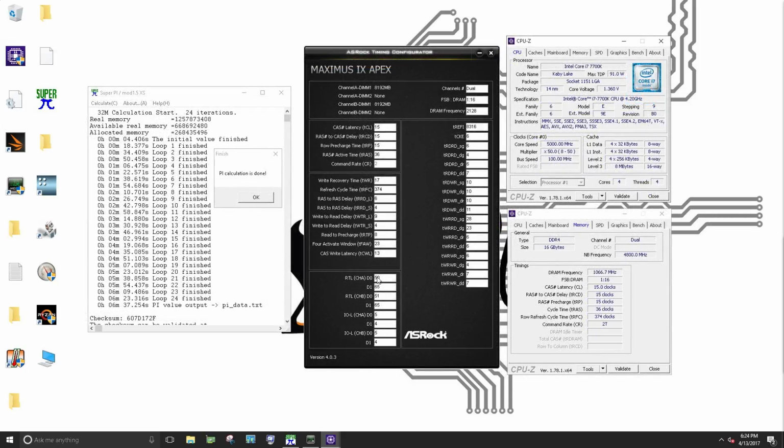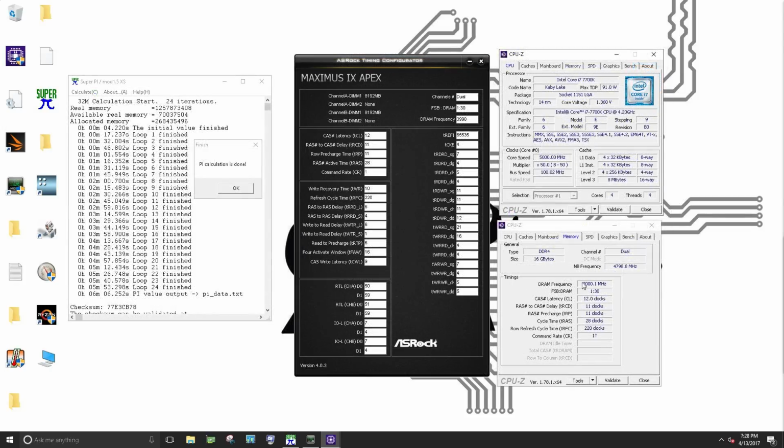So this is bone stock. This is 213315 again. 6 minutes, 37 seconds, right? 5 gigahertz CPU clock, 4.8 gigahertz ring, or core cache clock, whatever you want to call it. And then we go to DDR4 4000. Timings of 12, 11, 11, 28, 1T. Custom secondaries, like manual secondaries, manual RTLs, manual tertiary timings.